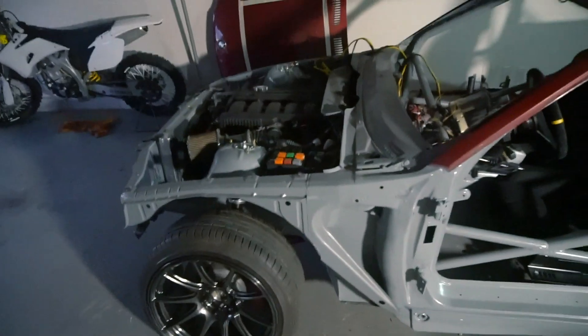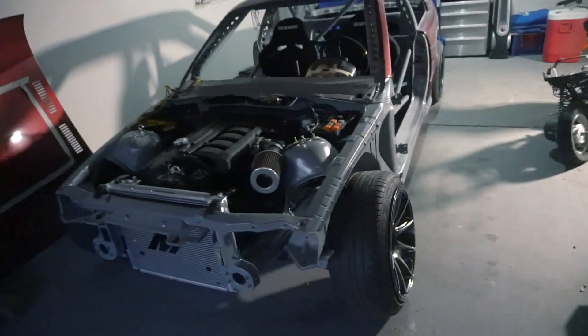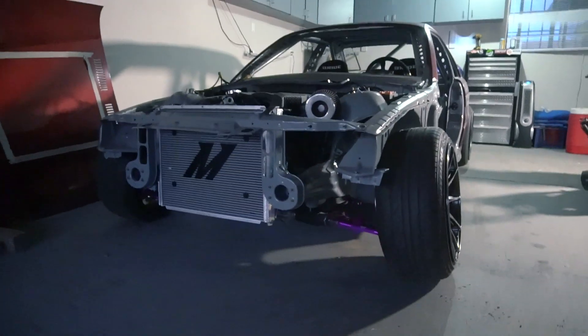I've kind of been doing a bad job keeping up with updates on the E36 because I've been waiting on parts. Once I got the wheel adapters on, I couldn't use the lug nuts they gave me because they're too short and were falling within the wheel, so I had to order lug nuts. It's all on now. I took the whole body kit off so I can do my final fitting with it off — I have to trim some of the side skirts because of the wheels when they turn. Look how mean this thing looks on the ground. Technically right now I can drive it. I don't want to drive it crazy because the brakes I just bled feel a little weird, so I'm not going to go on the actual street. But I should be able to start it, get it in gear, and actually start rolling — this might be the first drive in the E36, boys.